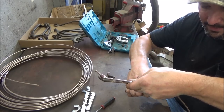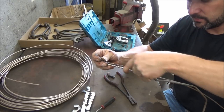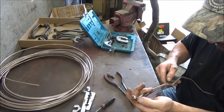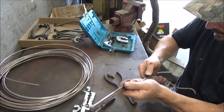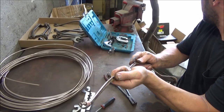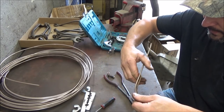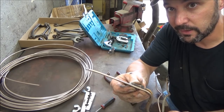But the closer you get it — if you're able to get the lines out in one piece — the easier your job will be going back together, because you'll be able to just take it over and snap it in, essentially. So you just kind of mimic them like that, and of course it's forgiving. You can just hook it up on point A and point B and tweak it a little bit if you need to. Bend that around, bend it up, make our last bend, and then we'll take our line, measure it, cut it, and make our last flare.